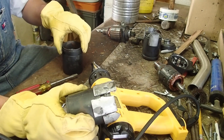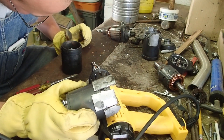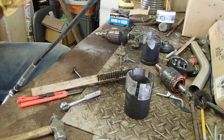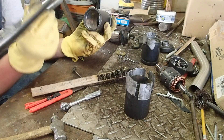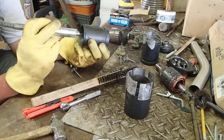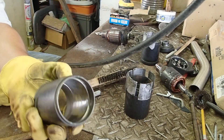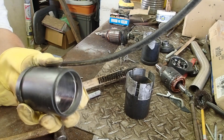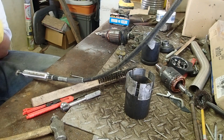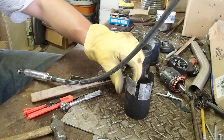I need to pull the last two magnets out — they're loose though. I don't know if that starter case is going to be salvageable — it's got glue all over the inside. I've been using my grinder with a wire brush wheel on it to try to clean out the glue. It's not perfect, but it's a whole lot better than it was. It's about as clean as I'm going to get it. I'll clean it out before I glue it, but as far as getting what's on there off, it's about as good as it's going to get. I'm going to do the same to the magnets.